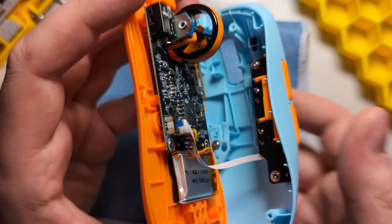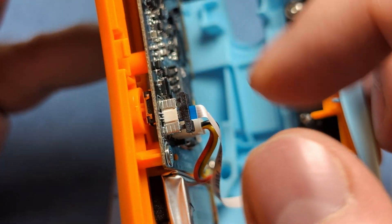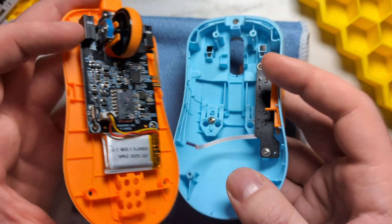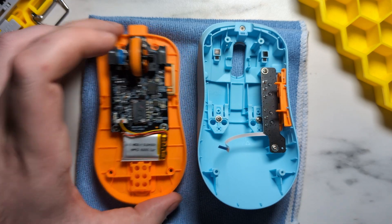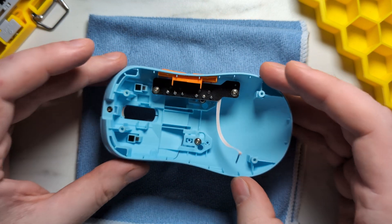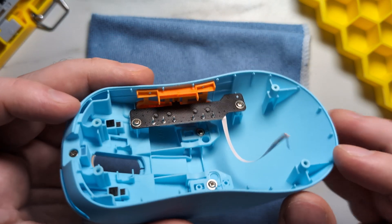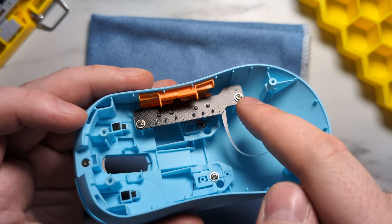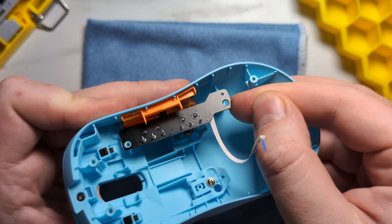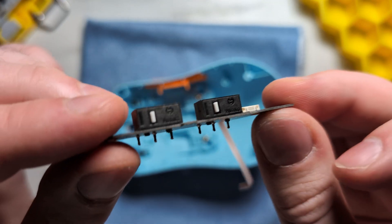Put the shells in between each other, then take your fingers and pull up on the side of this connector. Then you can just gently pull the ribbon cable out. Once that's done, the top and bottom shells have been disconnected. Set the base off to the side and focus on the top shell first. The first thing we can do with the top shell is remove the side button PCB — remove a screw from here and the screw from here. Then gently pull up on the side of this connector and that will knock it off. Do the same on the other side and the side button PCB will pop off.